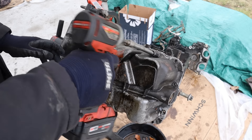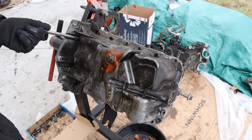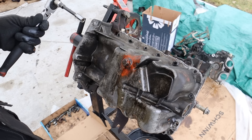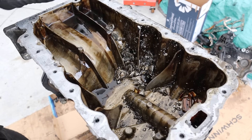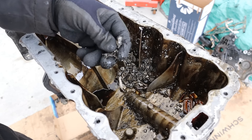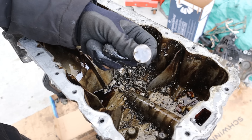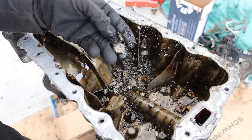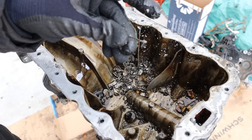Next I'm going to remove all the E-Torx bolts that hold the oil pan on. Now this is a stupid design — they've recessed the oil pan so tight I can't even get my socket in there, and even a regular 10mm socket can't fit in there. Turns out an 8mm socket will also take out those E10s. Oil pan off. Check out the contents of this oil pan — it's just completely obliterated. This is likely the piston. This here is the timing chain guide. And it looks like that valve we were missing from the head made its way down to the oil pan somehow. That looks like an oil control ring — the corrugated kind of ring.